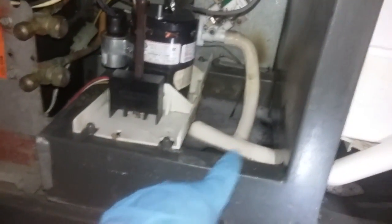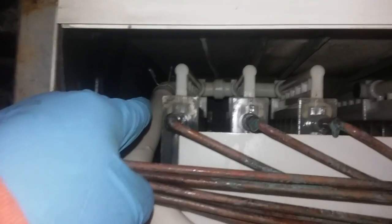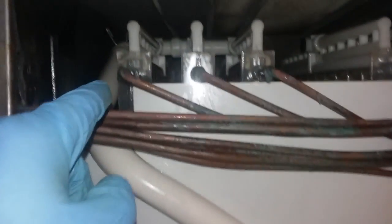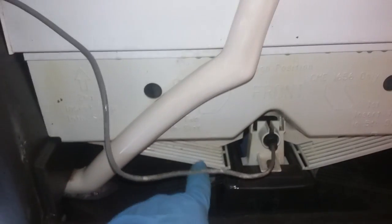I took the panels off here and here. The reservoir — I'm going to pull the motor out, pull this tubing out that goes up into the evaporator up there. That's where it feeds the water over the evaporators. I'm going to pull all that out, pull all those plastic parts out, pull this panel, all the plastic, the trays down here — all that's going to come out and get acid washed.